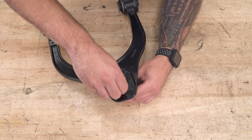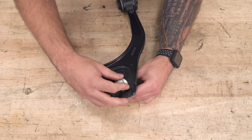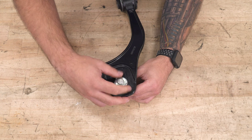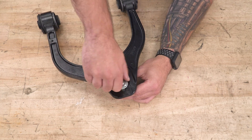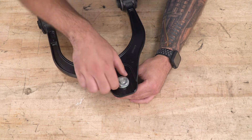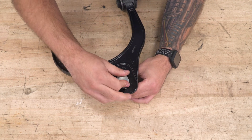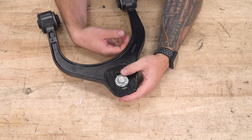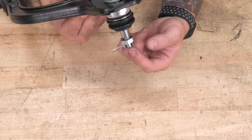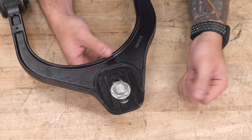You want to determine what position you're looking to have — a little more toe-in or factory spec — it really depends on your specific circumstances. Consult with your alignment shop if that's what you're working on. In my opinion, it's worth getting it to the closest zero or neutral position just to make sure you have a drivable vehicle to get it to a shop. You want to make sure it's safe to get on the road. Once this is bolted down to the suspension assembly with the castle nut, we're going to torque the top down here to 120 foot-pounds.